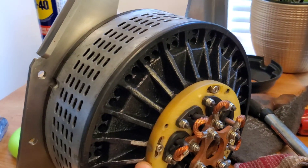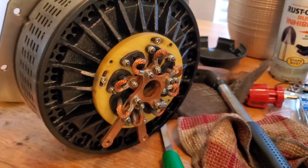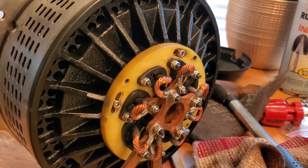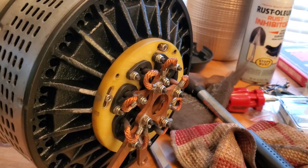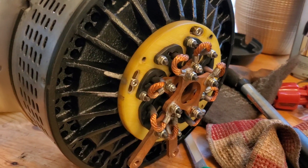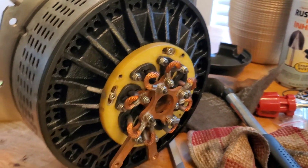The next thing you're going to want to do — very important — if you have brush DCs, you're going to take the brush holder out and inspect them. You want to make sure that the brushes are in good condition. They're generally spring-loaded. You want to make sure that there's no catching and stuff like that, and that you have enough brush wear left so that you can run the boat for another year. I'll show a video about how I do that — I did a video last year, but I'll put it in the description or maybe somewhere on the player itself.